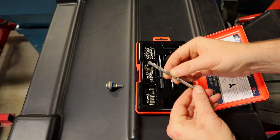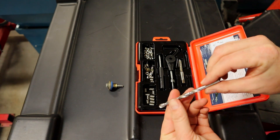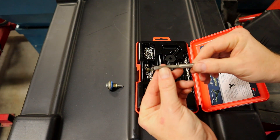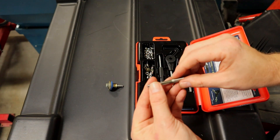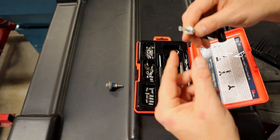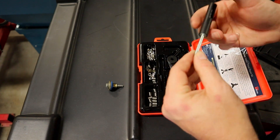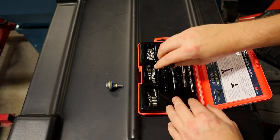You have the drill bit. We're going to use this drill bit right here and very carefully drill out the hole that is stripped out. Then we're going to take this tap and re-tap the threads. You're going to need some thread lubricant or cutting oil as well. This is the special tool for installation of the coil, and this is a magnet tool that we use to break off and retrieve the tang at the bottom of the coil.